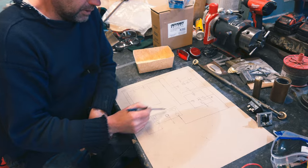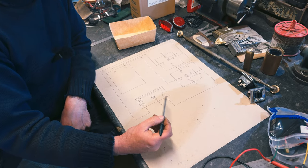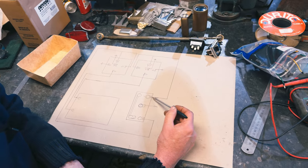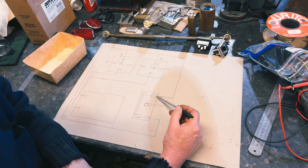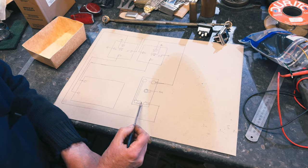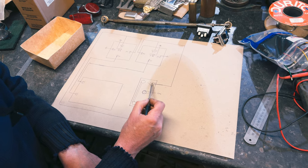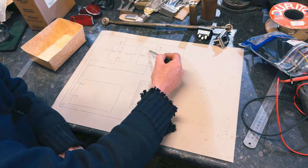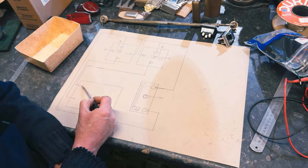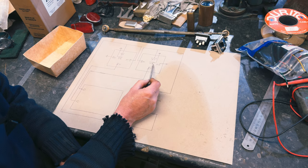So remember, there's our switch that we were just looking at, weren't we? So we've got ignition live, and then it triggers either relay, doesn't it? So if you go this way, you're bridging those two across. And it's living that up, but we're not using that. We make sure we don't have that connected to anything. So all it's doing is going across there, going up to here, to our relay, then out to our motor. And then that one's just becoming an earth, and this is becoming alive.